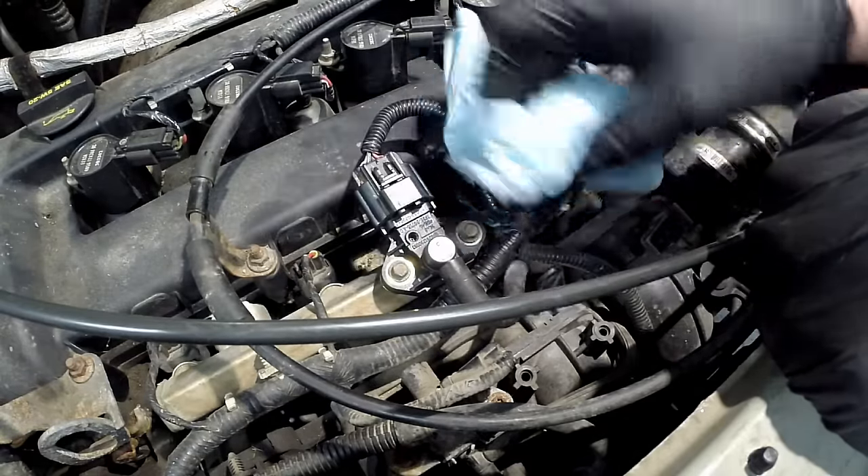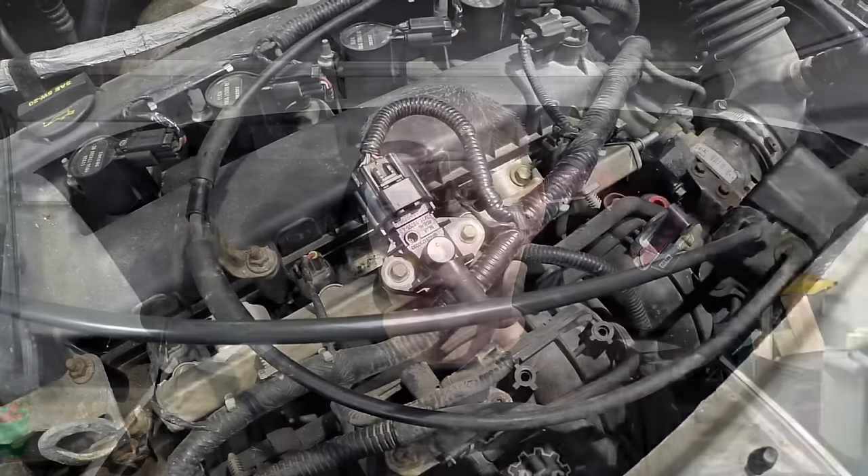Changing the sensor out is very simple, but you need to follow those precautions so you don't get a face full of fuel or start your vehicle on fire. Make sure it's a cold engine, use only hand tools, have plenty of rags to soak up fuel in case it sprays out, loosen those screws to let the pressure out if there is any, and be safe about it.